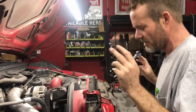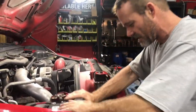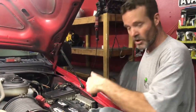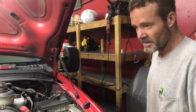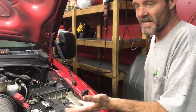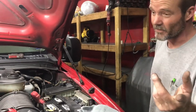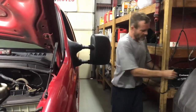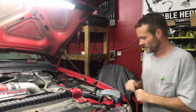When we're doing injectors it's nice to have room in the tray to set stuff, so just get the batteries out — don't try to halfway do it. Just get both batteries out; it's only two 8-millimeter bolts. Look — this one doesn't even have any hold downs on it. So this one's actually out right now and they didn't even have hold downs. We need to put hold downs on it to bolt the batteries down. That's why the estimate of however much we tell you it's gonna cost can very rarely stay there — unless we just say to heck with it. We have the ability to get the hold downs. Get them from the parts store — Dorman sells them, it's a battery hold down.